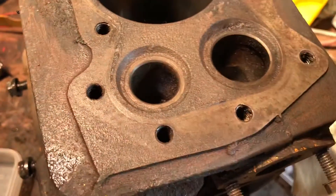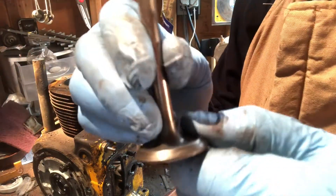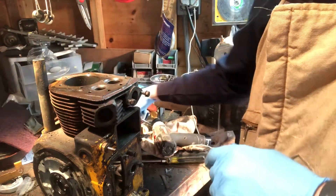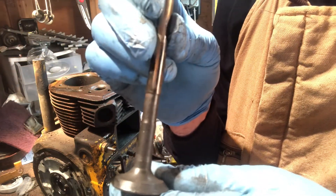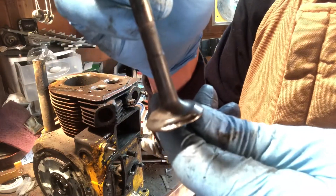I'll have to take a look and see how good these valve seats look. I'll get the valves lifted — put a valve in a drill and just spin it and see how it looks. It seems okay. I'll put it on the wire wheel and then take a closer look. Cleaned up the valves. The intake looks good like they normally do — there's not much wear on it, looks nice and clean, really no pitting. So this is definitely going to be reused. The exhaust valve on the other hand — as I rotate it — look at that gouge. It's definitely been beaten on one side. I don't know why, but it's definitely not good.